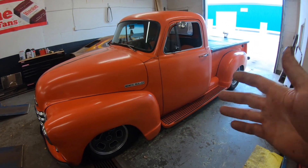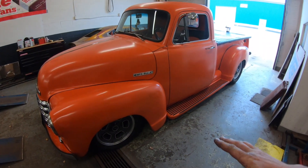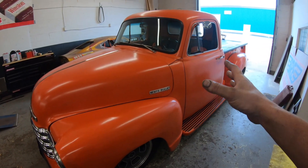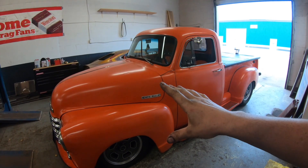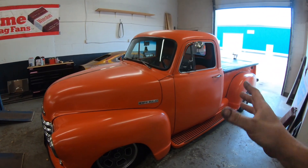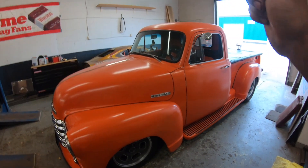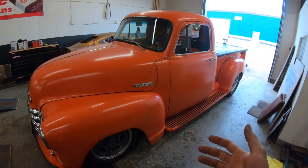It's just kind of like what it comes down to with carburetors — a lot of guys will throw a carburetor on and just expect it to be perfect, and sometimes it is. Just like the Sniper, sometimes the base calibration will be fine, and sometimes it's not. But anyone that's jetted carburetors and played around like that knows it's a lot of work. When it comes to EFI, guys get a little nervous with their laptops and electronics, but really a Sniper EFI is just like a carburetor with a thousand jets in it — lots of adjustments, lots of tweaking. At the end of the day, there's no reason that a Sniper EFI can't run better than a carburetor. It's way more sophisticated — there's a lot of powerful technology in a Sniper EFI, just like the same technology used in Terminator systems. Guys are running thousands of horsepower on software just like what you're running in your Sniper. This is throttle body injection versus port injection, but the software and adjustability are the same — it's amazing what you can do with these.